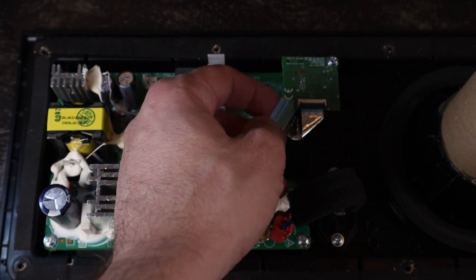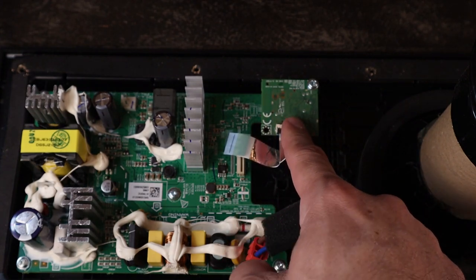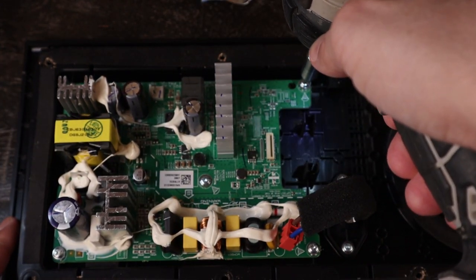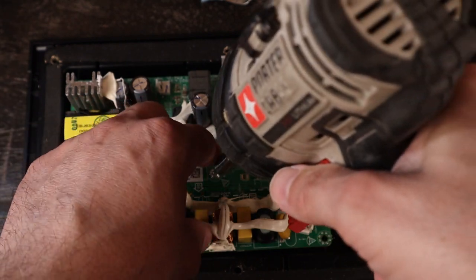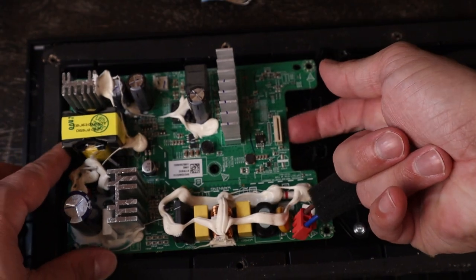The next step is to remove the actual board. Before we remove the board, we got to move this small one here, and then there's five screws that need to be removed on the larger board — just one screw on this small one. You got the five screws that are kind of in plain sight, except for the one in the middle which you might miss. So don't forget that one. When you take these all out, don't try to pry them off because sometimes it might be held on by a screw that you don't even see. That's it, that's out — that simple.